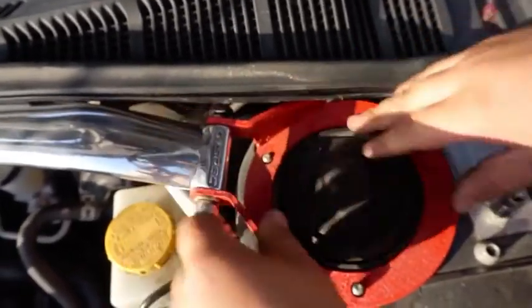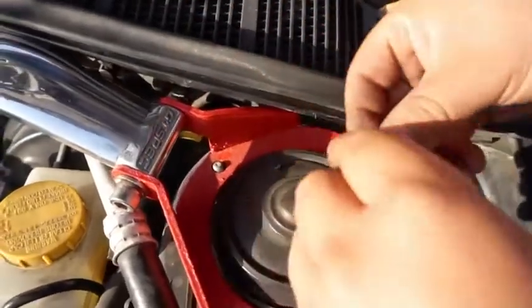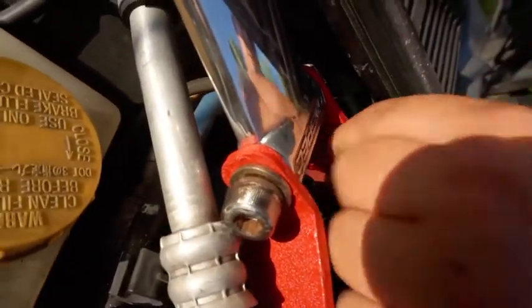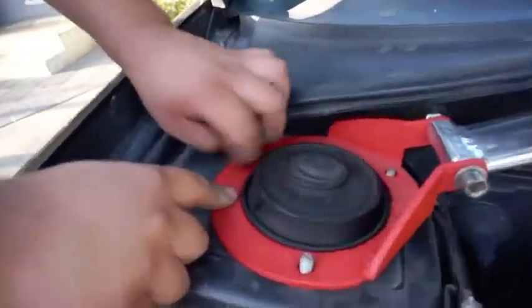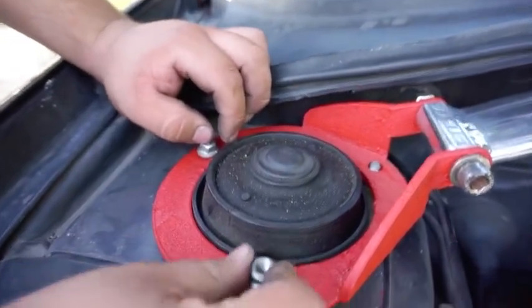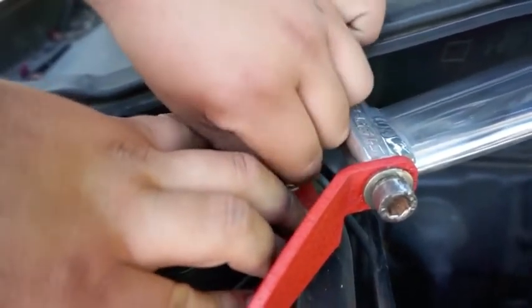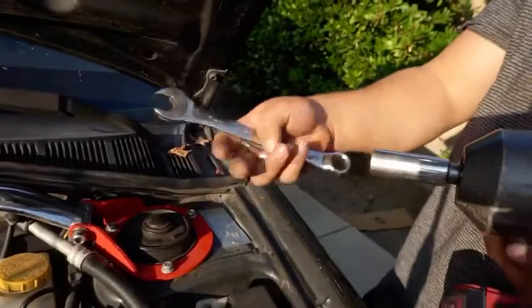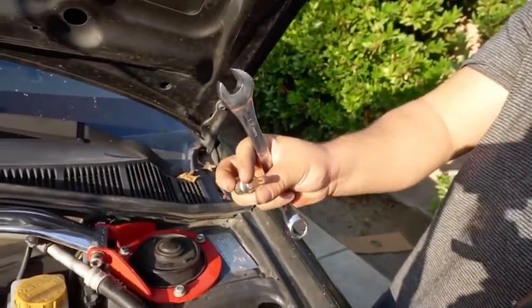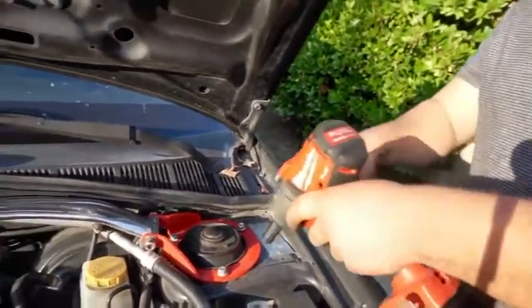All right, we're on. Let's put these bolts on now and tighten everything up. This one we got to push right here. This is the GT spec for the 2002-2007 Subaru Imprezas — may also fit Foresters and stuff but I have no clue. And we're in business! All right, let's tighten that down. So all the tools you need: it's a 12 for the top three, this one's a T50 since I don't have the Allen and it works just fine, and the 17 for the back nut right there. Let's tighten it all down.